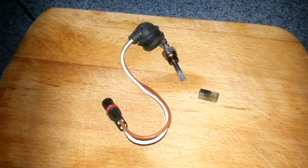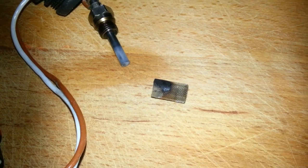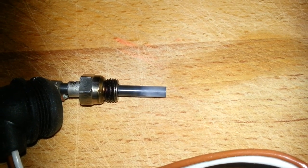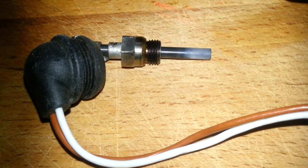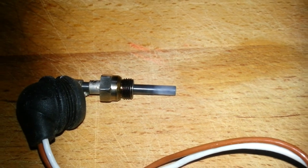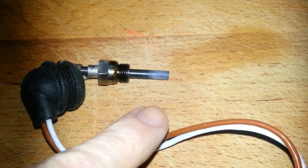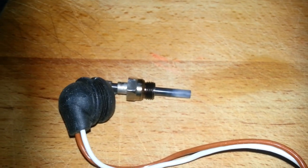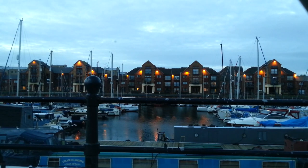I've taken the Eberspacher apart. This is the glow plug and the atomizer screen. The atomizer screen in particular, as you can see, is very badly coked up. The glow plug is still nice and straight — generally, when glow plugs have had enough, the tip begins to round off or swell out and get quite large, which is a sign they need replacing. This one should in theory be alright, but the inside of the combustion chamber is horribly coked up and it's going to have to go in for cleaning. So it's off to the service centre for the Eberspacher.